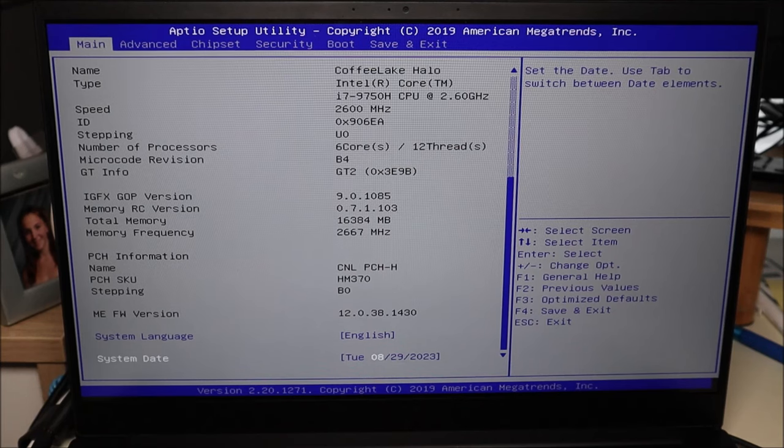After you change the date and time, save and exit and keep booting up, but keep an eye on that date and time. If after you shut your computer down and the next time you boot up your date and time is wrong again, that means your motherboard BIOS is not keeping its settings when the computer powers down — most likely because it's losing power. There's a CMOS battery on the motherboard designed to keep power to your motherboard even when the computer is off. That could be a sign that battery has failed and needs to be replaced. There'll be a video link on screen and below in the description showing you how to access and replace that battery.